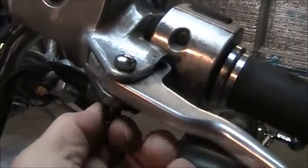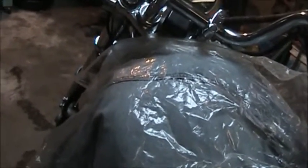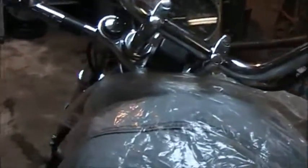So I got these loose — I'll just pop that out and set it on my bench where I know it's safe. Pull that out a little bit and the lever should come right off. Now, before you start anything with brake fluid, cover up anything with paint, because brake fluid will eat paint right off. I've got an old jacket and a piece of plastic to cover my tank and side cover, so that if any brake fluid drips it doesn't drip on my paint.